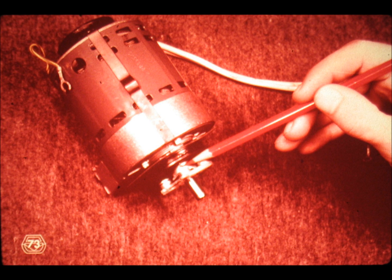Slide number 73. The clutch hub is adjustable sideways on the motor shaft by loosening the set screw. This hub is adjusted in conjunction with the adjustment of the position of the motor. When reinstalling, the motor must be positioned front to rear so as to establish maximum belt tension, but without causing the drive mechanism to become noisy.